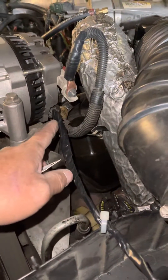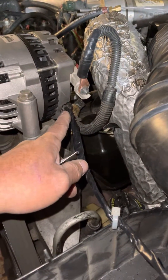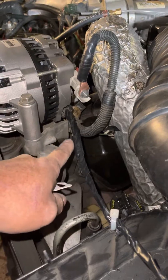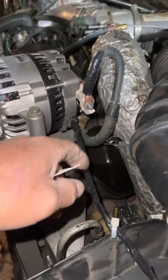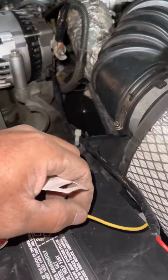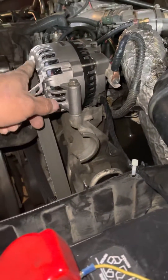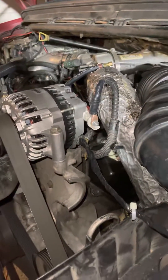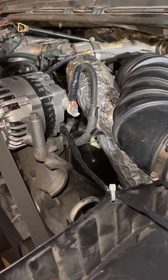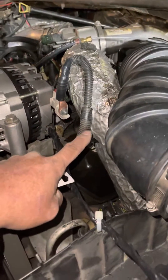What I did was pigtail into the wiring harness and bring a red wire out with my resistor and diode. When you turn the key on, it now has a voltage supply to the exciter wire. That exciter wire supplies electricity to the field and, in combination with the other wire, allows the alternator to charge.